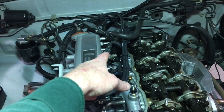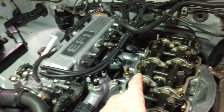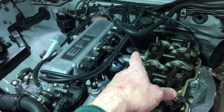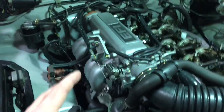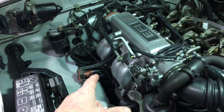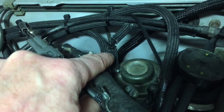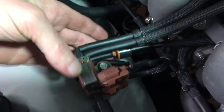I also disconnected the cold start injector. The other day I pulled the connector harness going to each injector to make sure those were all firing — they were. For the test drive this afternoon I disabled all the smog stuff: the air injection system, the air suction system, and the EGR. To disable the EGR you just pull this hose off and cap it off. On the air suction you just cap that hose off that runs down to the air suction valve.